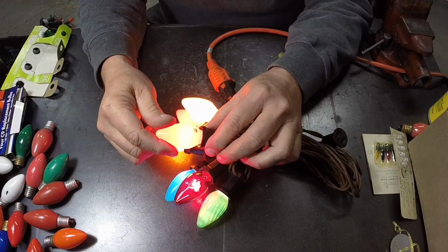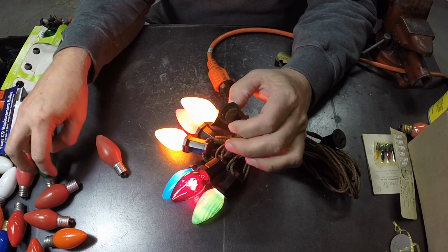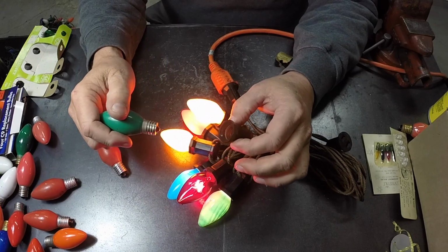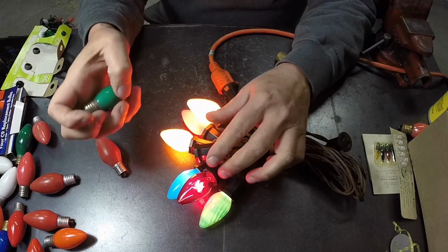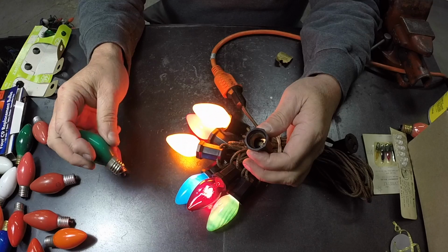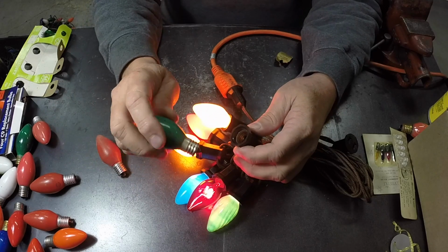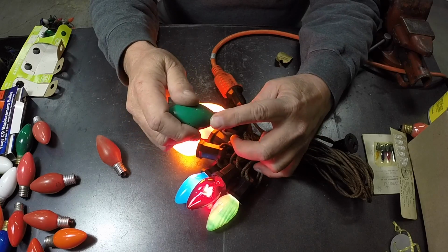And all these bulbs work, and I'm thinking this might be a good set because the wiring actually looks really good, and it's not those pinprick sockets. Those other ones, these little pricks just go through the wire insulation. You get a little corrosion from a couple of years use or something in there, and you twist the wire such they stop illuminating, or somebody over tightens the bulb and it pulls the ground one up.